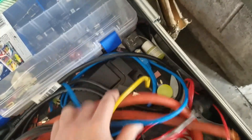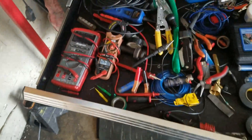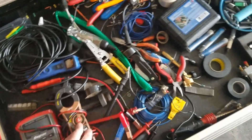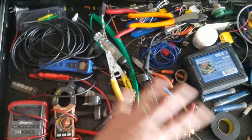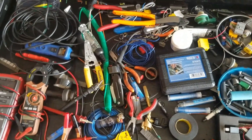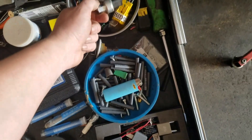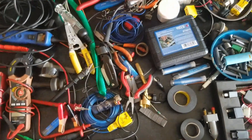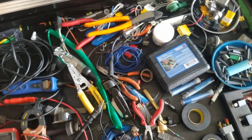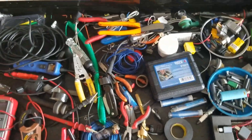This is all years and years of collection — you don't really need all this stuff to do diagnostics. What you need to start with is a meter; you can do all your basic testing with a meter. As a flat-rate technician, anything you can purchase that helps you diagnose something faster is worth it. But if you're doing it in your parents' garage on jack stands where time isn't important, just use whatever you've got. Go to Harbor Freight and buy one of the eleven-dollar ones — most of them are actually pretty accurate, but I wouldn't do any major diagnostics with them.